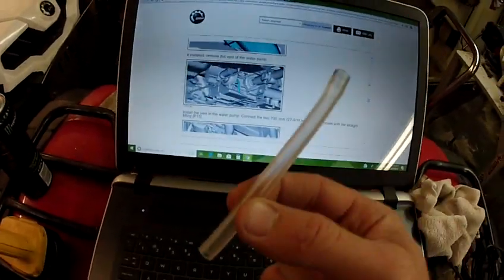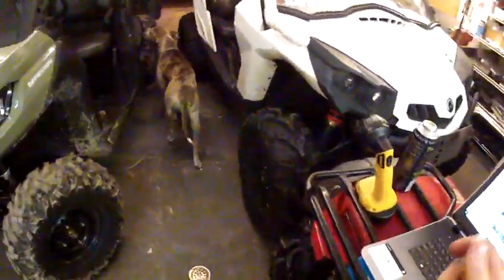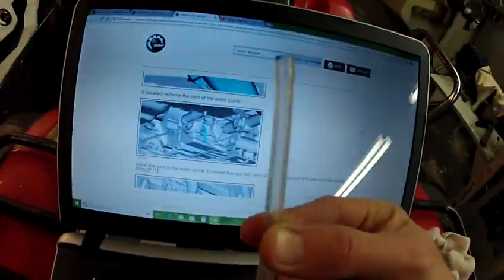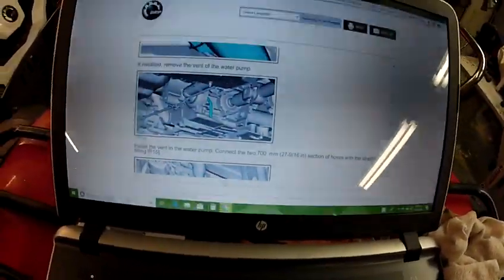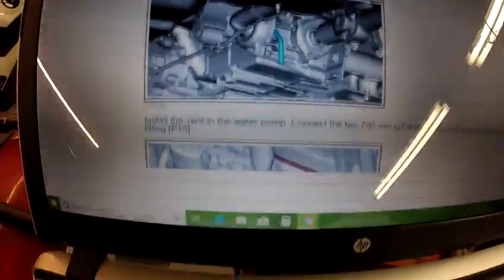So when you buy these things new, I'm guessing, do not submerge them in the water. You gotta run the vent tube up high. See, I ran all mine up to the roof. And I got those wrapped around the snorkel. But real important, I don't know if it causes damage, but they told me if I'm snorkeling it, run this thing up high. So that's kind of ridiculous, but I'm just letting you guys know ahead of time that's what it is.